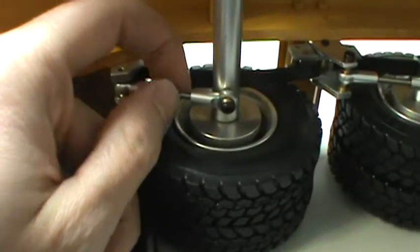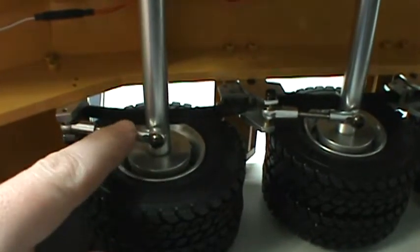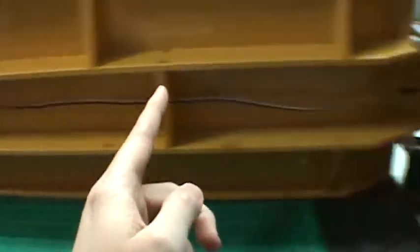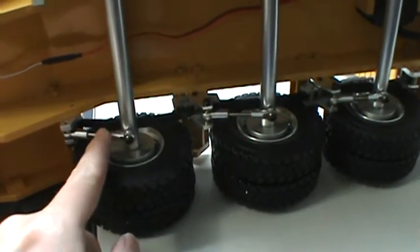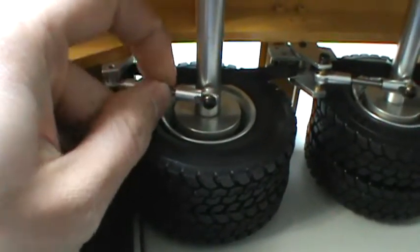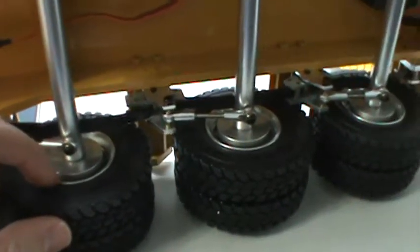These are adjustable. So once I get ready to start Loctiting all this stuff in, I've got to do alignment on this trailer. I'm going to run from somewhere up here that's perfectly aligned with everything else and run measuring back to the first axle, line these up and Loctite them in, and then Loctite these in after I get them set where I want. Because they just thread back and forth. There's nothing holding them, so the vibration works these axles all out of alignment.